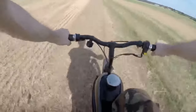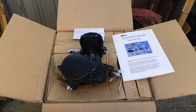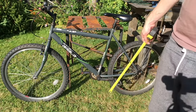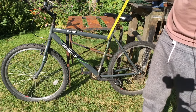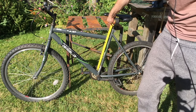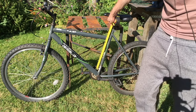We're going to be building this motorized two-stroke bike. This is the engine kit - I'll put links in the description below, you can get it off Amazon. The bike you use needs to have a distance from the bottom bracket to the top tube of a minimum of around 34 centimeters. Any less than that and the engine's not going to fit.